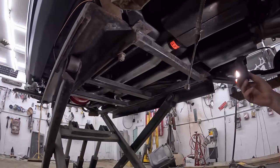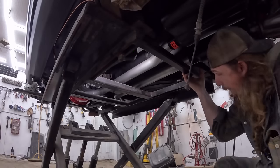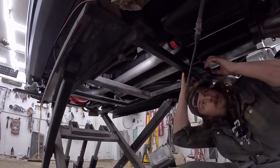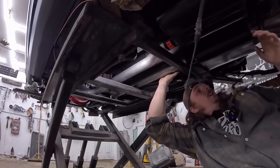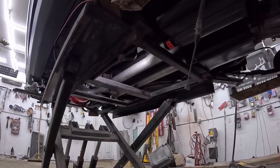All right, sorry guys — you're going to have to listen to the heater chug along because it's cold and I'm sensitive. Pull this yoke out. I'm going to just pull this whole exhaust out. Jammed it in there like an idiot. Let's pop these muffs right off and see if we can get this all dialed together. I'm going to chop this exhaust up a little bit — the H-pipe's cool, but it's really getting in a guy's way.